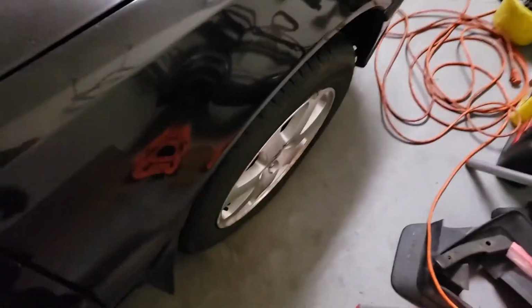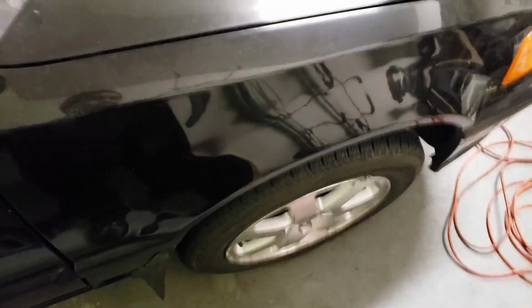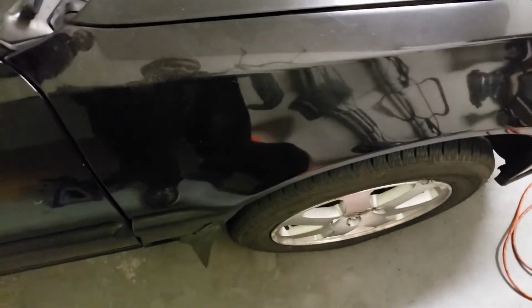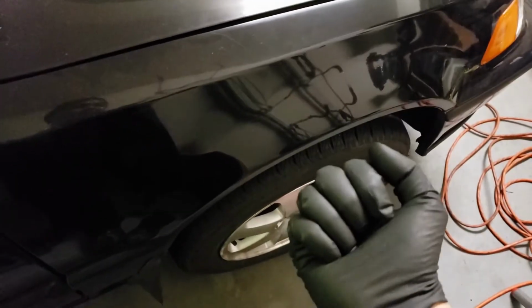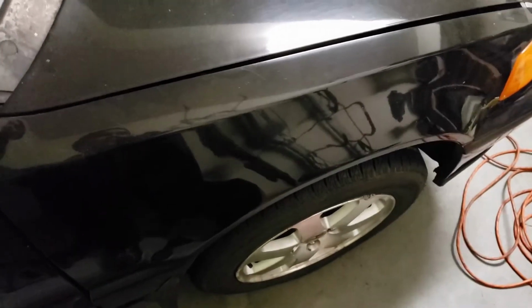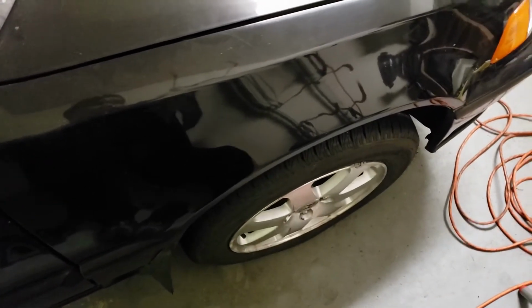So, with the help of my girlfriend shaking the steering wheel while I look for that sound, it sounds like it's coming from this side on the tie rod. So I guess the rack end bushing is gone, because you could feel it bundle up. I mean, you can feel the clicking and clunking on the tie rod. So as I hold on to the outer tie rod, you can feel that clunk, clunk, clunk as she's shifting it back and forth. So it's definitely the rack end bushing.